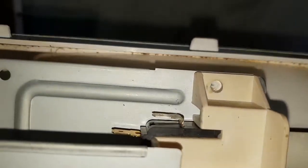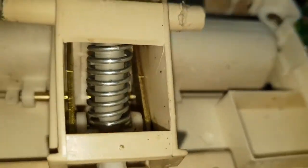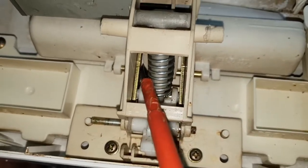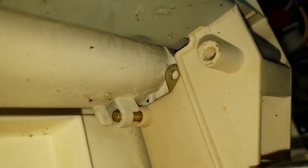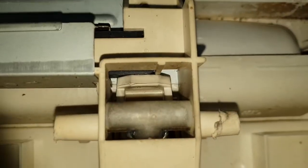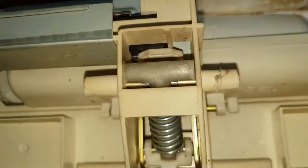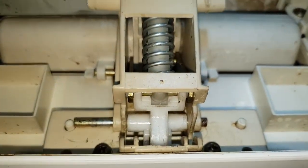What I did is I unplugged these cables - they were plugged into the micro switch on the lock. I did manage to reset the lock by just pulling this up. These copper bars on the inside - let me just check - they can move up and down. But strange to me is that on the side they've got a hole; they seem like they're supposed to go into this shaft. Because it doesn't matter what position the lock is in, it always engages the micro switch. There's a little tab for the micro switch and it's always engaged - that should not be the case.